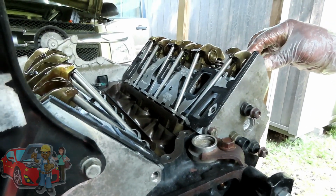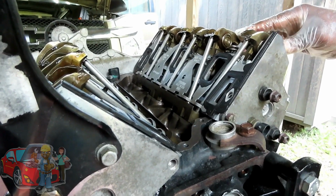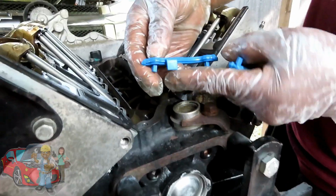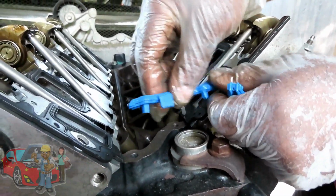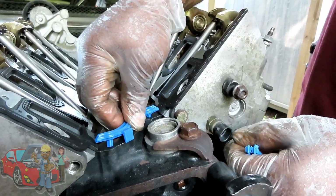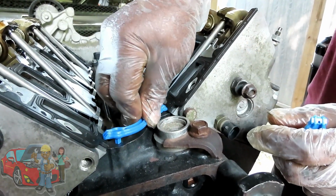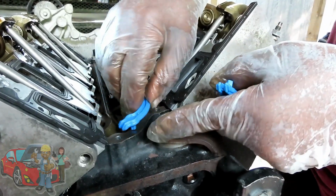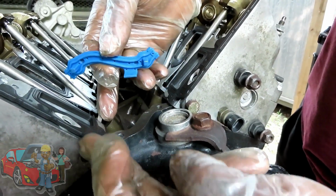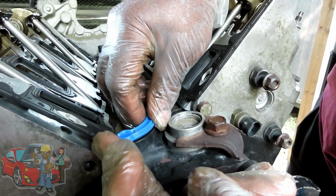Alright guys, everything is looking fantastico. The next thing we're going to do is put on our end seals right here. Now, you're going to have a little lip that hooks on. If you try to put it on this way, as you can see, it won't work, so don't try it. That lip has got to be on the inside. Put it on the inside, it lines up perfectly. Now, this thing slides up under. We should have put these on first, but it's okay. Just going to have to pick up on the gasket a little bit and put it up under there.